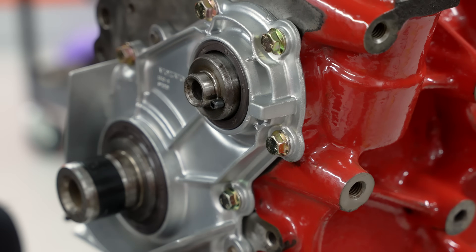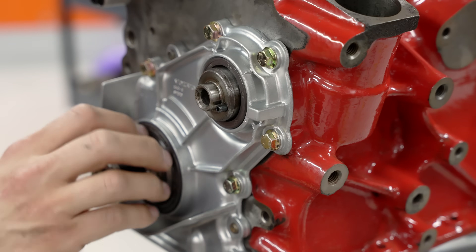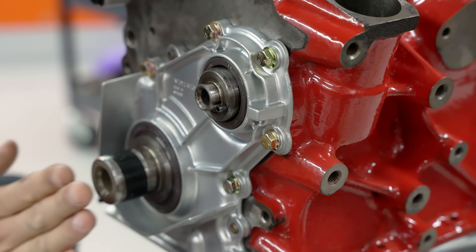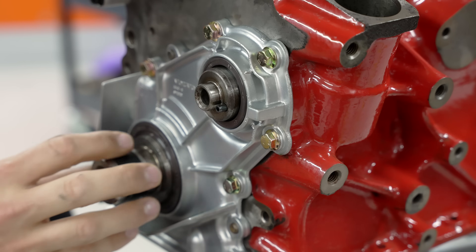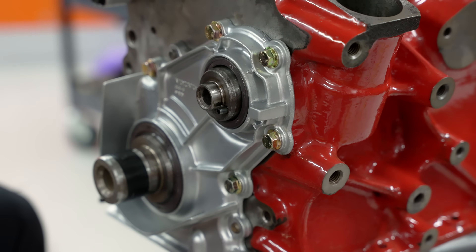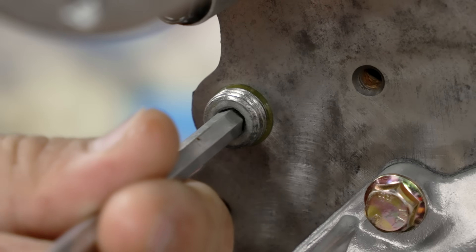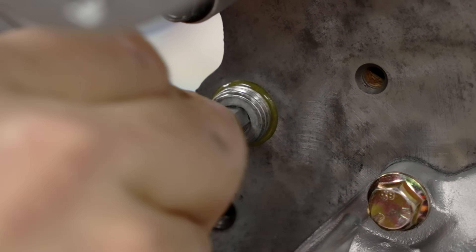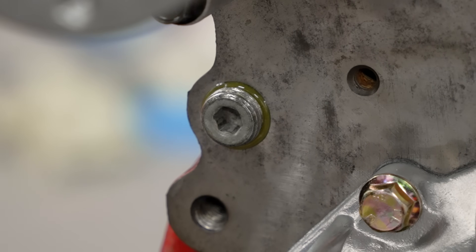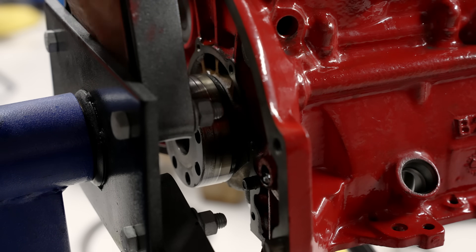That should be fine. Of course it would be preferred to have the correct tool to press it on there, but I don't have anything like that. Maybe that is something for the webshop — I can possibly make something that'll automatically stop against the crank and align it perfectly, but for the time being this is the best we can do. Remember we talked about these oil galleries before? Well, this is the port leading into it, and you definitely want to make sure you plug this up, or else you will have oil just everywhere. There's no specific torque needed, just make sure it's tightened down.